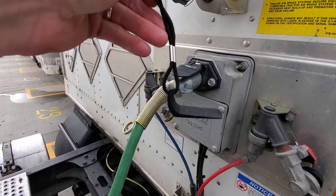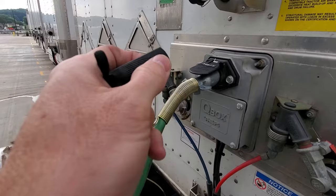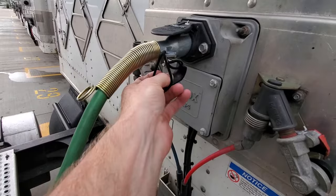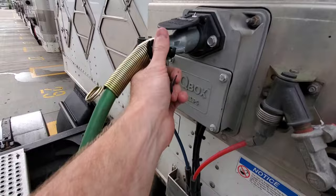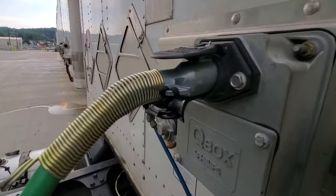So I've come up with the pigtail wedge — a simple little plastic tool. It's thin at the tip and thicker as it goes back, so it works on almost every trailer. Some trailers it'll go in a little bit, some trailers a lot. Move the pigtail back and forth, figure out where you need it to keep the lights on, slide it in, and you've got lights.